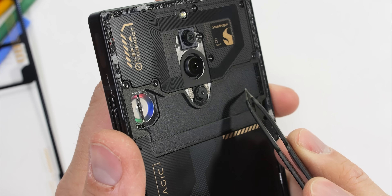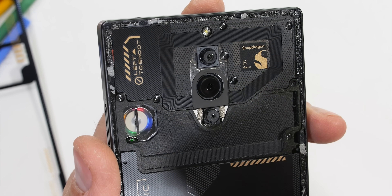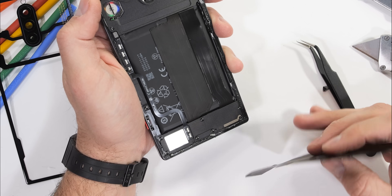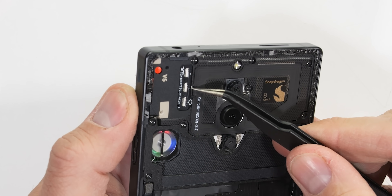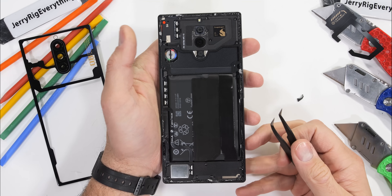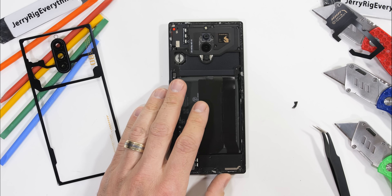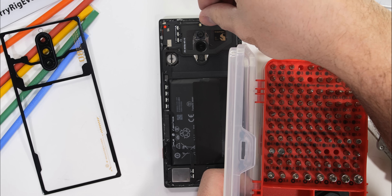Sitting between the glass and the internal components of the phone, air is pulled in from the right side and spit out the left side by the red, green, blue, and orange colored fan. Pulling off the decorative plastics on both the bottom and top of the phone, we see quite a few LEDs running along the left edge — nine total. Nowhere near the 972 LEDs we found inside the Nothing Phone, but any RGB is a good RGB. Nubia has deviated slightly from normal by using 18 T3 screws instead of Phillips head screws, presumably for aesthetic purposes.